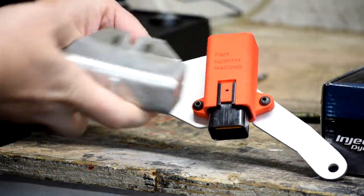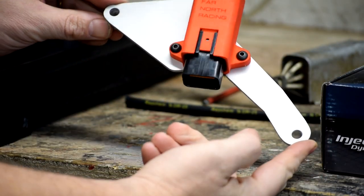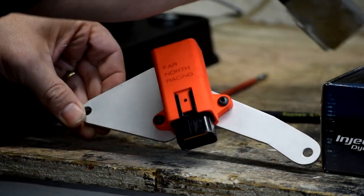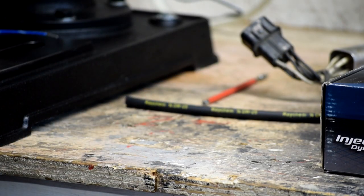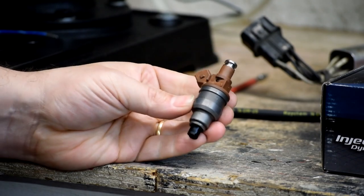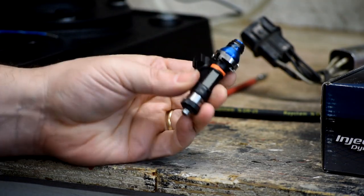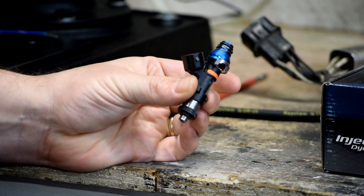Comparing that to the original — it looks pretty nice. I went ahead and made an aluminum plate for this to bolt to, so it bolts up against the firewall and occupies the same space as the original. With all those parts in place, we now have a wiring harness, our new injector, and our resistor pack eliminator. We can go ahead and mount all three things to the car to transfer from the old style 1990s low impedance lower flow injector to a modern high flow, high impedance injector.